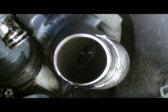On the bearing, the fan's fairly loose. So the turbo's sticking, losing power. I'll just pull it out and see. There's a fair bit of wear on the bearing on the turbo there.